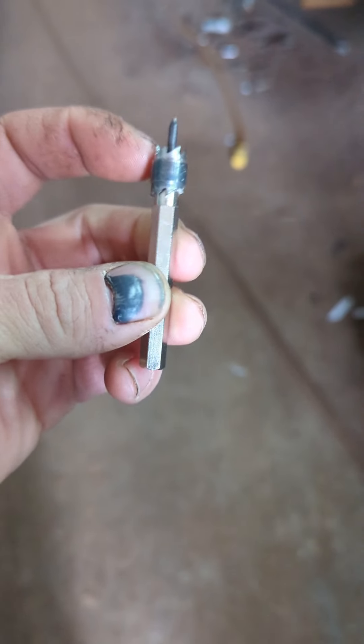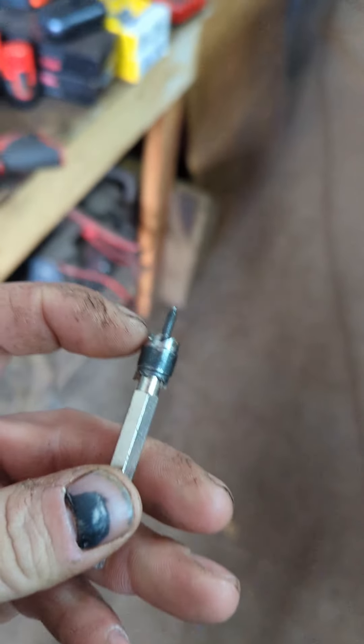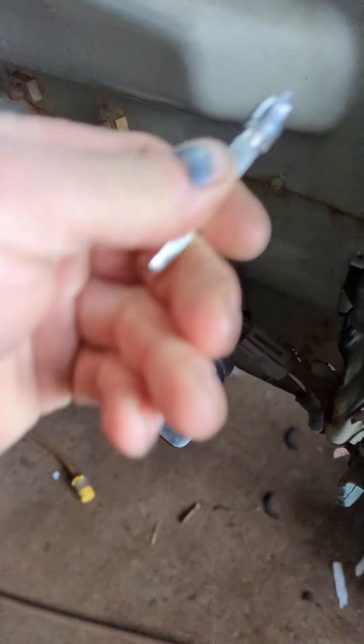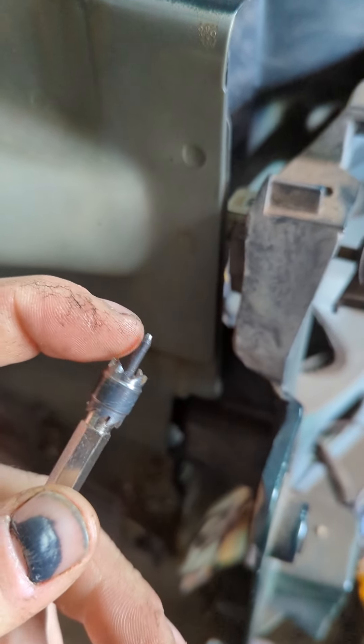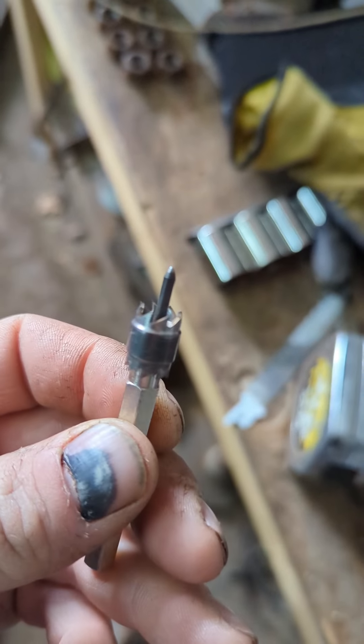This bit is changeable, and this is the only bit that I've used. I did everything on the passenger side with it and some on the driver's side, and I've only used one bit. It comes with like 14 more, so I should be able to drill out everything. What I recommend is when you're drilling out the spot weld, take a punch and punch the center — that'll help keep this point in the center when you're drilling it out. One of the teeth is kind of munched up pretty bad so I need to change that, but it's working great. For $20, you can't beat it.